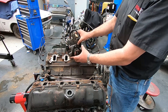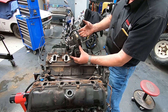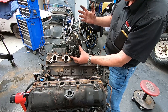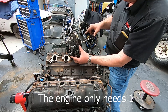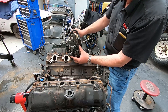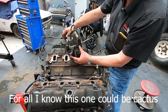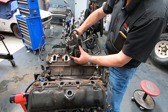Now obviously I'm going to pull the PMD off the side here. This had two other PMDs in it and both of them seem to be wired up — don't know how it was working. But there's just no point in leaving that there, may as well keep it as a spare for whatever reason. Apparently these things have a habit of just getting hot and dying. But yes, I now have a very pretty injector pump.